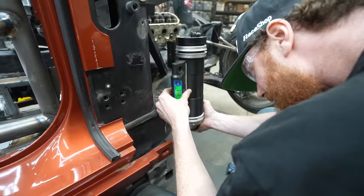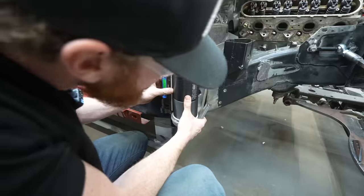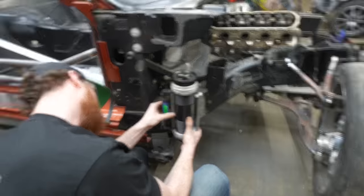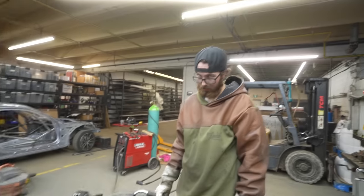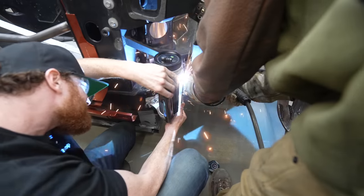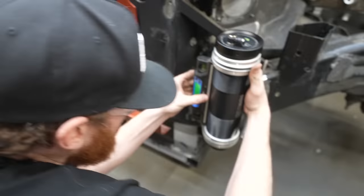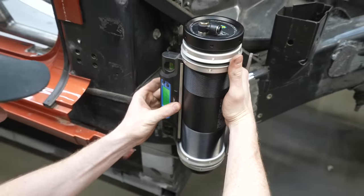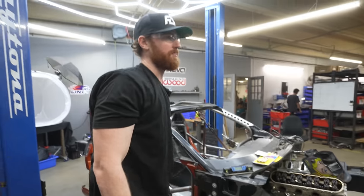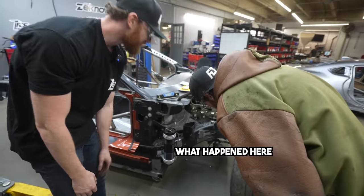That's not square. Cam, re-tack me. 89.9 — oh, it says 90. We're in trouble. Okay, tack the top. 89.8 and 89.9. There you go. Done. We're off by 0.1 of a degree. Throw me a tack there. It's not bolted, man — it's held up by a piece of welding wire. Relax. Do you think three tacks will pick up this car with the boat anchor in it? It'll at least peel one, which will then result in the other two also peeling.